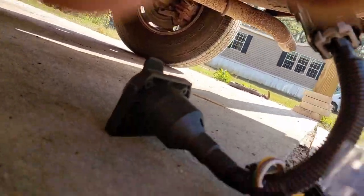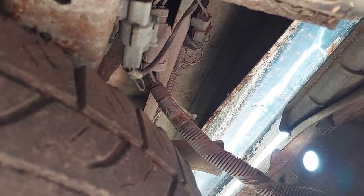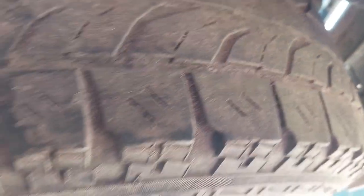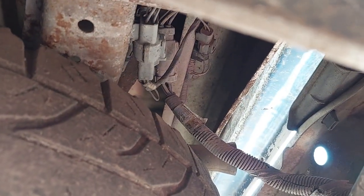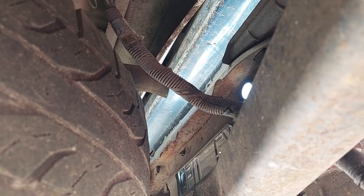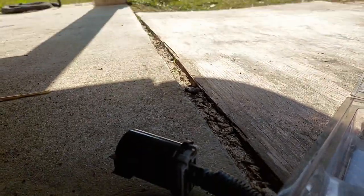Getting this swapped is a little bit more difficult, because as I showed, our harness leg here goes over the hitch and then up into the frame — it's really difficult to get to as it stands. So what we're probably going to need to do is drop the spare tire. I think that'll give me the room I need to get up in there, though I might be able to do it from below. The connector up at the rail is a push-it-down-and-then-pull-it-free type, so let me mess with it a little bit and see what I can get.